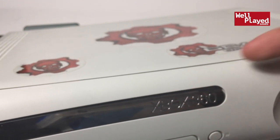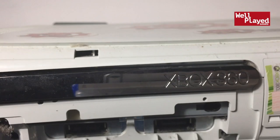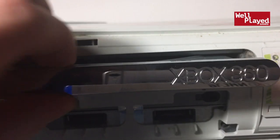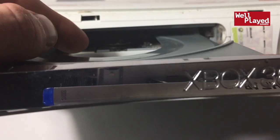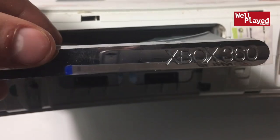Something interesting happened — the disc tray just closed on me, so now I have to figure out how to get it back open without the elastic in it. The front panel has been removed, so let's just open this thing back up. That was a fail! You can see the gears back there — those gears were moving the band we removed, and that's what makes the tray open and close.